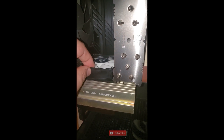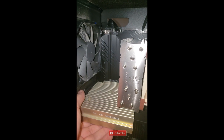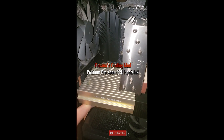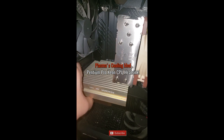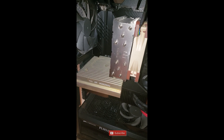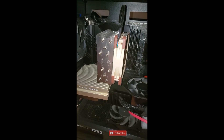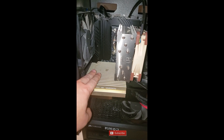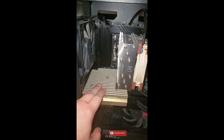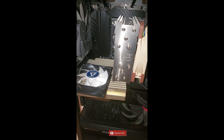I've got an 8-centimeter fan, a little stopper so that this beast doesn't move, and what this is - it's actually a heat sink from a Pentium Pro CPU. It's pretty much stuck on to the top of the video card with double-sided thermal pads, because there is no fan on the back there. There's a fan down here and a fan up here on the 3090, but up here you've got a whole bunch of memory right underneath it. By putting this heat sink here and adding a fan on top of it, I've been able to drop the temperature of the VRMs by about 20 degrees.